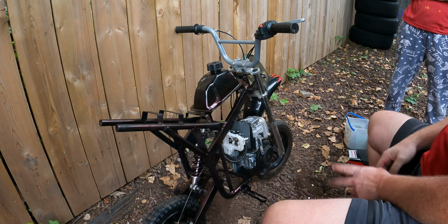But it revs up nice, and it sounds good idling. Everything works on it except the carburetor's not working right. So there's something wrong with the float. Maybe I gotta adjust it or something. Everything was really gunged up, and when I pulled it all apart, I might've bent it slightly, which would make it not right. So I might take the carb back off.